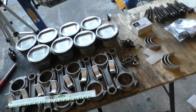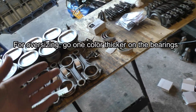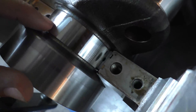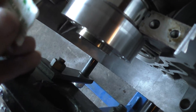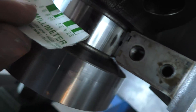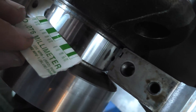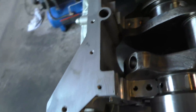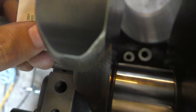If the clearance is within a safe range I won't go through the extra step of proper measurement. If the clearances look too big and are right at the margin, I'll probably go through oversizing the bearings. After taking all the end caps off, the plastic strip is now crushed to this line. The Plastigauge comes with a comparison gauge — you compare the thickness to the gauge to get a value in millimeters. The first one is right around 0.025mm, the second is 0.038mm, the third is 0.038mm, the fourth was between those two values, and the fifth is also 0.038mm.